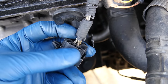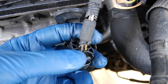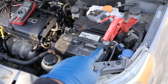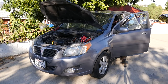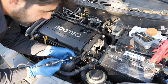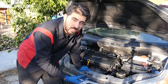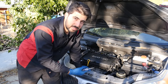This constant ground is for the sensing side of the heated oxygen sensor. One would suspect the other wire to be the switched ground for the heating element. To verify, we keep the test light to the positive side of the battery and turn on the engine. Good thing we verified — it's actually the other pin, the one on the bottom. So now we've identified three wires out of four on the harness side, and the last remaining one is the signal wire.